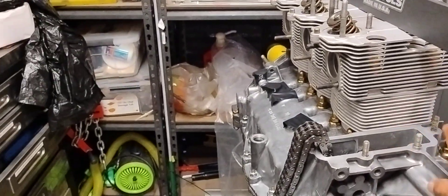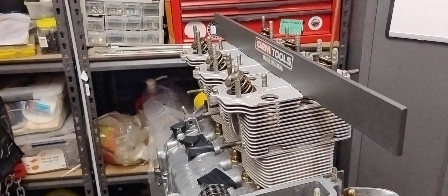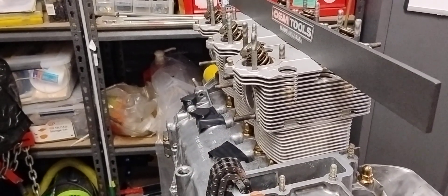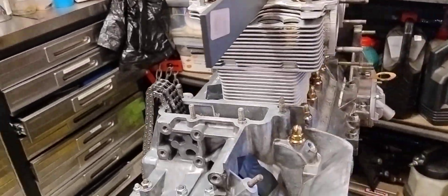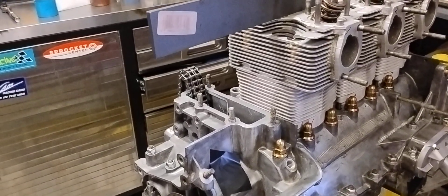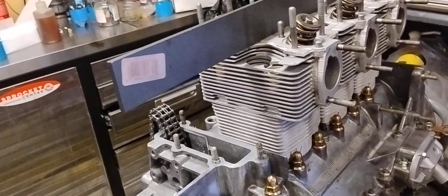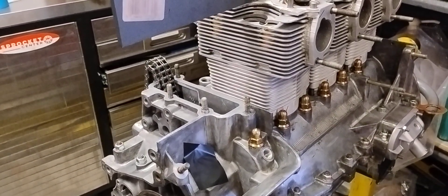I've got no issues with camshaft housings and camshaft rotation, so it's good to check this along the way. What I'm going to do now is put on my camshaft tower, then also a chain box with a gasket, put a camshaft through and the thrust plate — the camshaft thrust plate — and just line everything up to make sure it's all still nice and central, because you can get two different thicknesses of gasket there as well. It's good to do all of this before your final assembly. It does take a lot of time — I know people say it takes 40 hours to build an engine, but if you're going to do it properly it takes a lot longer than 40 hours.